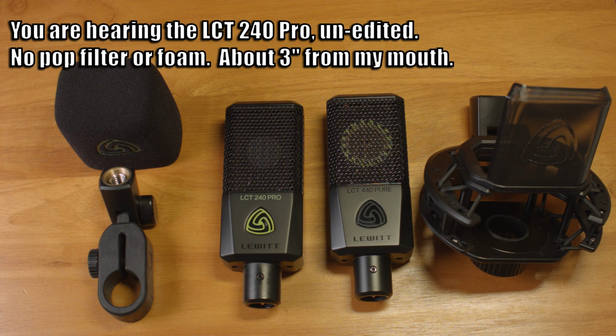And sure enough, the 440 Pure is a quieter microphone in terms of self-noise. The 440 Pure is rated at just 7 dBA of self-noise, while the 240 Pro is rated at 19 dBA. That difference is large enough to be audible in some situations, but it's not as if the 240 Pro is like a terribly noisy microphone or anything. The 440 Pure is also a bit more sensitive, so it should require slightly less gain from your preamp to achieve a given output level.